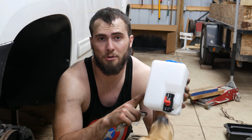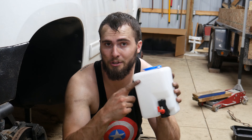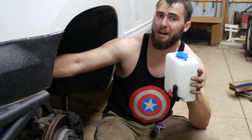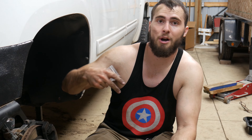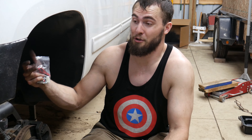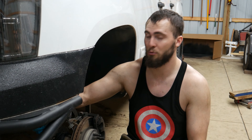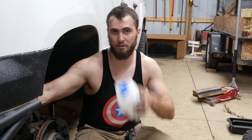This is our new windshield washer tank. It's obviously not as big as the last one, but because of where it's going to be located, you're pretty much going to be able to see how full it is. The reason I wanted this was because it was getting a lot of rubbing on the actual tank because of the size of my tires, and once I go to my wide body fenders and bigger tires, I know I'm going to be making contact with it, so I just want to get it out of the way now. There are two plugs that were in the old tank — one of them we're going to cut the wires and splice our new controller into. The other one was just a little fill mechanism, so you can just tape that off or plug it back in.